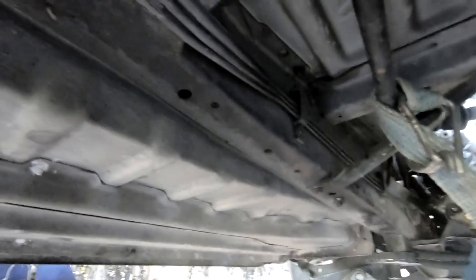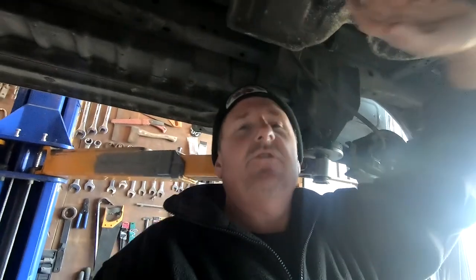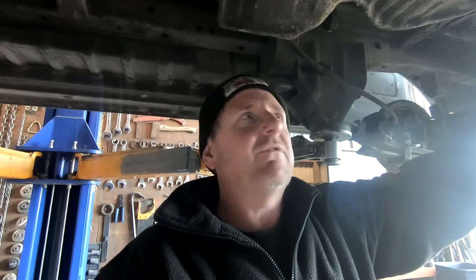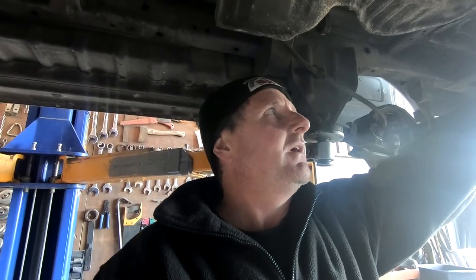We also did a bit of work on the fuel system — you'll notice there's only one fuel line now. Fuel systems, return lines, fitting fuel filters — I jokingly said we'll just make it returnless: put a fuel filter with the regulator in it at the back, put it over there, it'll be easy. And Jason liked that idea. So it now has a returnless dead-head style fuel filter fitted — the filter's got the return straight back to the tank, and the engine's going to get the fuel pressure regulator blanked off.